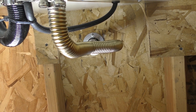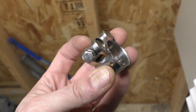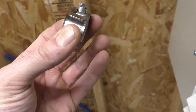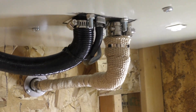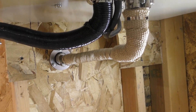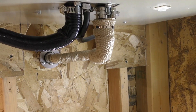In addition to this, I upgraded my clamps. I got some Mickey Mouse shaped heavy duty stainless steel exhaust clamps. I highly recommend getting these — they're only about $3 to $4 a piece but have a massive amount of clamping power and surface area, which will ensure the safety of your exhaust. I also wrapped it in one-inch heat tape designed for motorcycle exhausts. That'll prevent safety issues where wood falls underneath or the fuel line gets singed or melted.